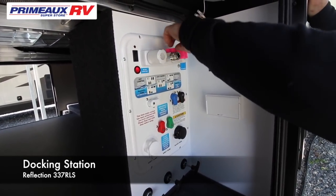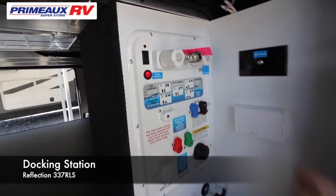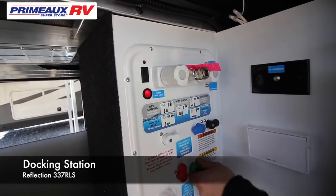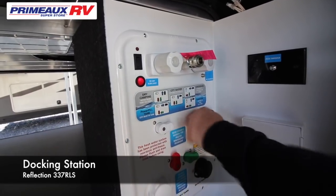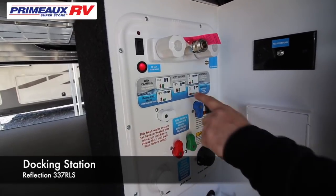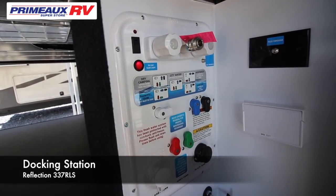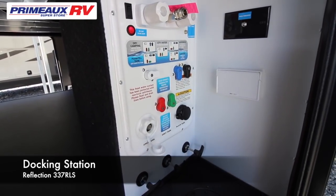Now here's where, depending on what you're going to be doing, is how you're going to set these handles. If you're going to be dry camping and you need to fill your tank, you put the handles like this and now you fill your tank. Once your tank is full and you're dry camping, you set your handles this way and turn on your water pump and that will pump through the camper. If you're going to plug into city water, you'd have your plugs here. Below this is where you're going to hook up your hose for city water and fill your fresh water tank.